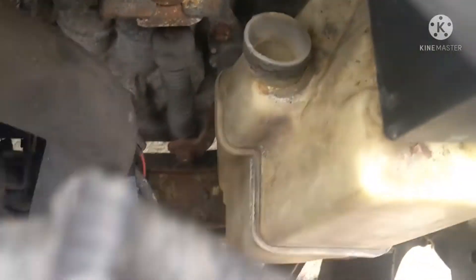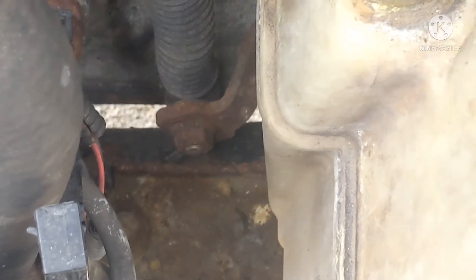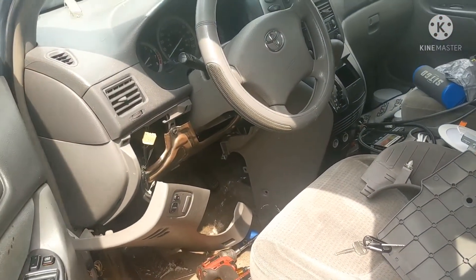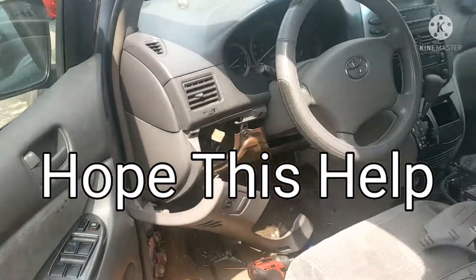So that's gonna be your fix. Come down here — you see the neutral safety switch, that's where the cable connects right there. You're gonna pull this all the way down, push it all the way down, and then you can get it back on Park and the vehicle will start. As always, please subscribe, like and share — I'll see you in the next one.